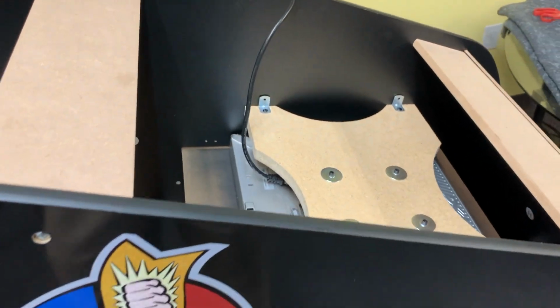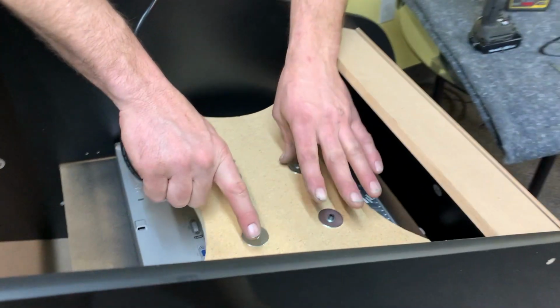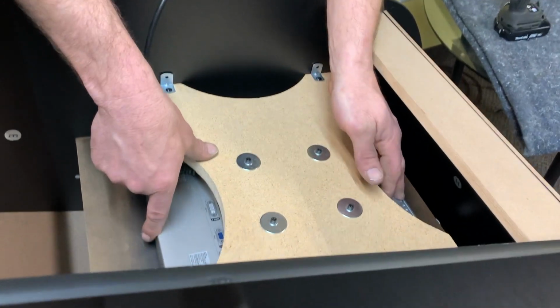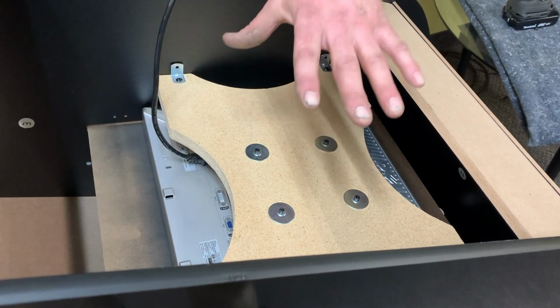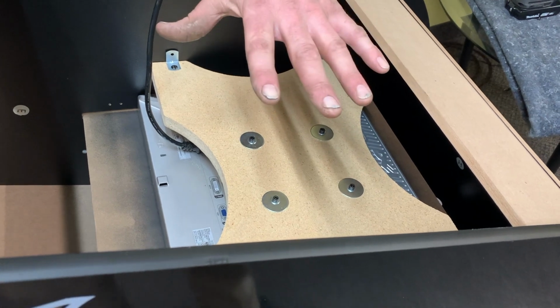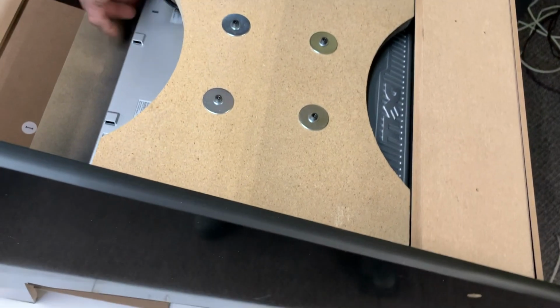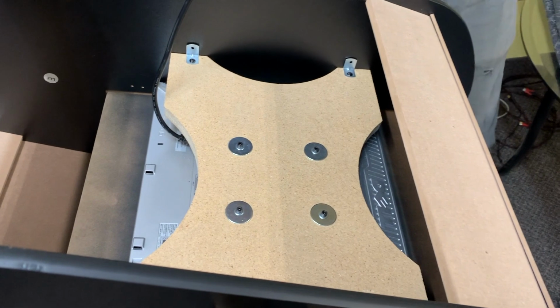So double check my position. Looks good. The monitor can be moved up and down in the slots a little bit and skewed a little bit later if you don't have it exactly right the first time. So then you can loosen these 4 Allen screws and shift it a little bit. But primarily we want the weight down on the weather stripping against the bezel so that it's nice and even and doesn't have higher pressure on one side than the other when you're doing this. That's why we're doing it flat and not on its side.